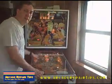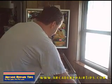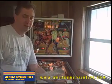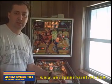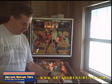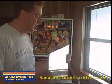You can slide the playfield glass. If you are ever replacing playfield glass, you want to make sure that you buy tempered glass. You can get this locally, but if you do a little research on the internet, sometimes it is cheaper buying it from some pinball suppliers than just having it cut and shipped. Make sure you use tempered glass.